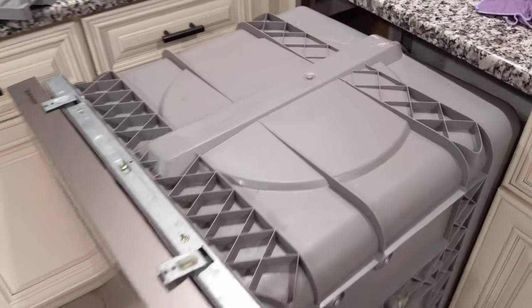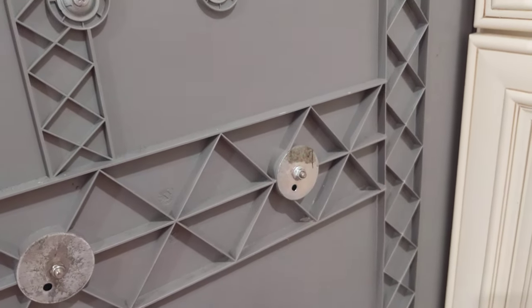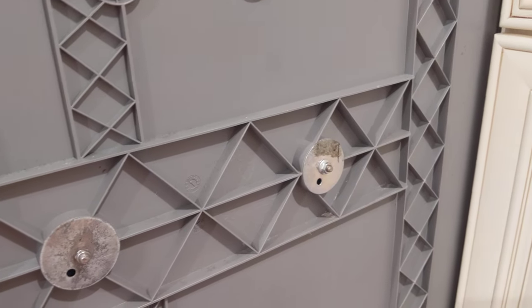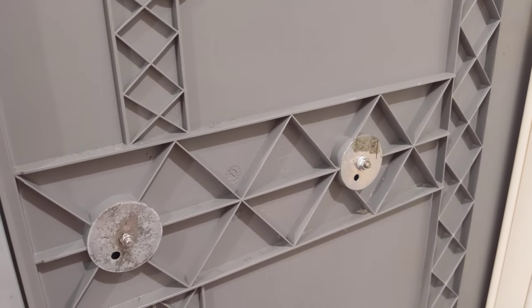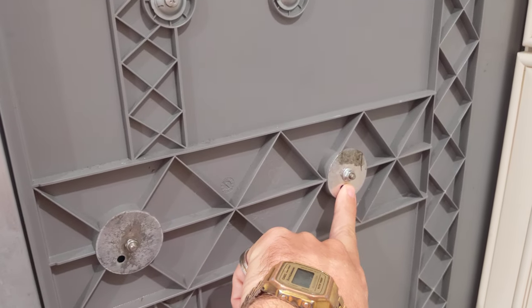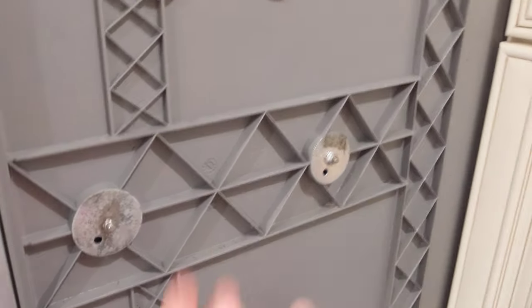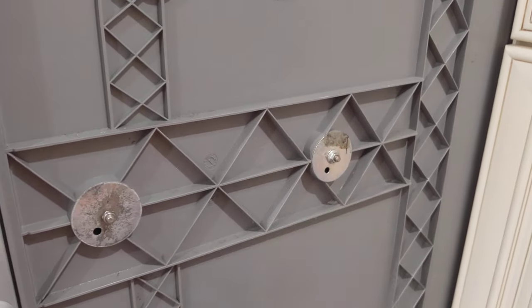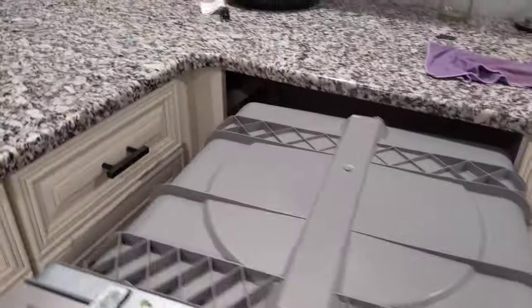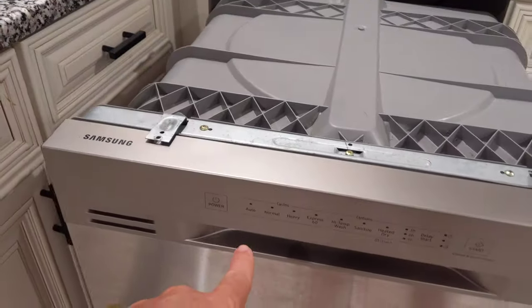There's an insulation blanket over the dishwasher for efficiency, but these things have an inherent problem leaking right out of a screw here — two little rubber o-rings inside that weren't tight. With the blanket trapping hot water and moisture, it creates a cozy spot for pests. We literally have pest control coming once a month because of a leaky screw. To fix it, I took it off, put a new rubber grommet on, sanded down the washer so it would seal better, and finally stopped the leak.